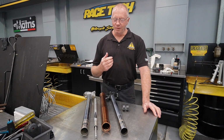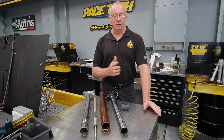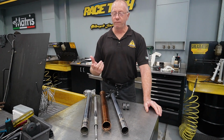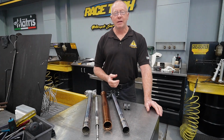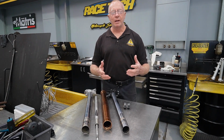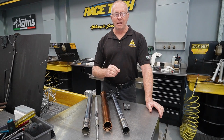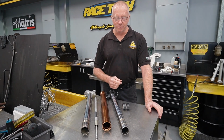Now, friction plays such a big part in what we do. For us, as suspension tuners, we're basically only dealing with three forces: spring forces, damping forces, and frictional forces. Anytime we have an excess of friction, that can create extra harshness or extra damping effect, if you like, but that damping effect is far less controlled than what you get from actual damping systems.